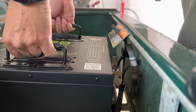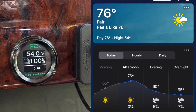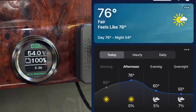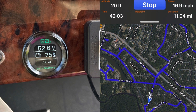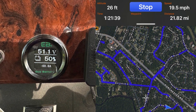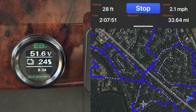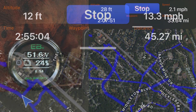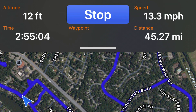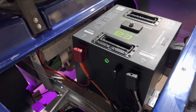Next we installed the Eco Battery. Their app had not released yet as of filming this video, so we monitored the dash-mounted voltage meter. At 75% we hit 11.04 miles, at 50% we were at 21.82 miles, at 25% we were at 33.64 miles, and the battery shut off at low voltage protection — zero percent — at 45.27 miles. The Eco battery also gave us full power until zero percent.